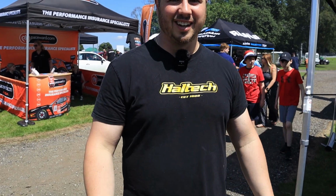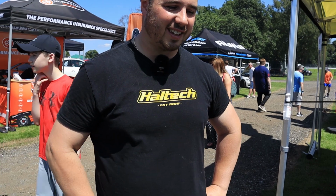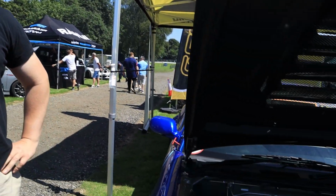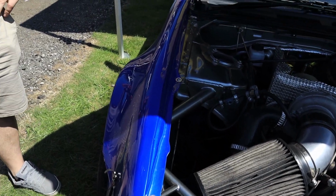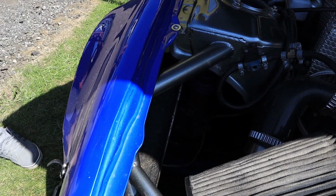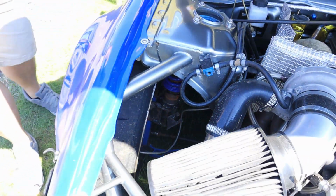As you say, a lot of the Japanese culture, cut knuckles, bang loads of light toe out. And that's quite an old thing now. The modern cars aren't doing that so much, but that used to be a thing, because back before we had the technology to have these kinds of levels of lock. How many degrees of lock can you get now? I think it's about 70, something. Yeah. So even the bottom arms are designed so that they don't interfere with the wheels as they rotate.